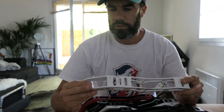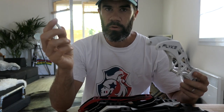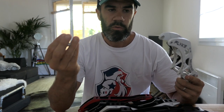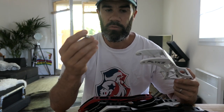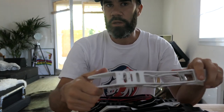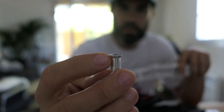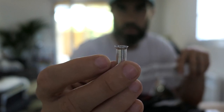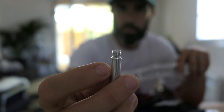One more detail is about the axle — it's quite common to lose them. It's very important not to use an axle from one brand on a different frame, because differences in sizing are the main reason why people lose wheels during training or races, or find their wheels get stuck and can't be removed. Make sure you have spare axles of the correct brand, because the small triangular shape and the length of this part are specific to almost every brand.